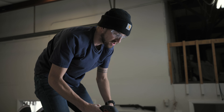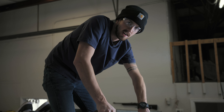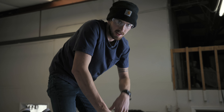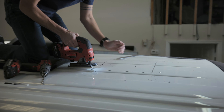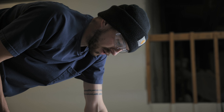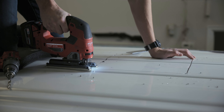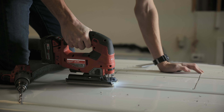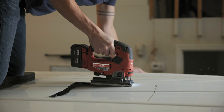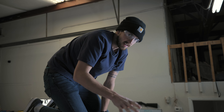Now that all the corner holes are drilled, we can get going with the jigsaw. Make sure you have a metal blade. You're going to run it along this edge — these fans have a little bit of grace on the outside, so it's better to cut on the outside of the lines so the fan fits, rather than having to sand the edges to make the fan wedge in. The flanges are big enough to cover what you need. Keep the jigsaw down on the surface, pull full power, and go nice and slow across the roof. One reason to do this before building the inside is so you don't get metal shards all over a nice floor or bed you've already put in.